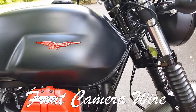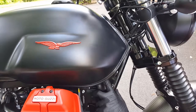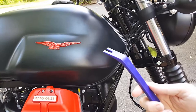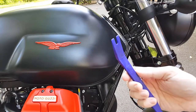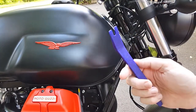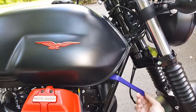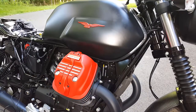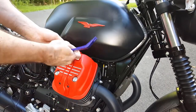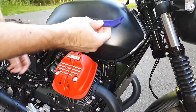Without taking the entire tank off I'm just going to drop this right through this little gap here and fish it down. I got these trim removal pieces from Manalord Auto Parts — I'll put the link in the description. Just a bunch of plastic and metal pieces and fasteners, coming in handy here because I'm using this to feed the wire backward far enough so I can grab it. This interior panel remover tool has a little slot so it's easy to catch a wire — I fed it through and then reached under and grabbed it with my hands. Takes a little bit of patience. I like that it's plastic so it doesn't scratch the paint.